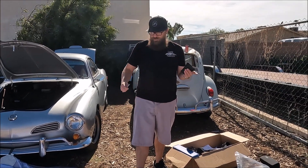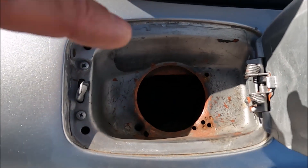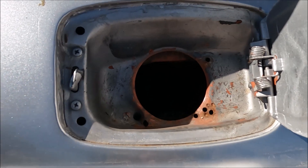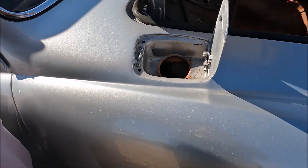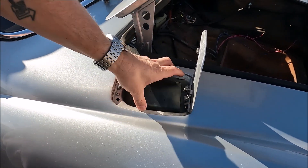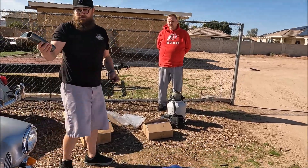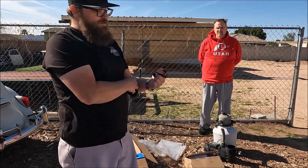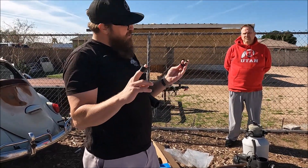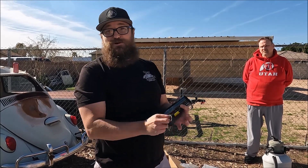I got a throttle cable tube for the engine. This is actually the seal for the fuel filler — at some point a whole bunch of extra holes were drilled in there. I'm guessing when it was converted to electric, the guy used this area for his charge port. We're probably not going to do anything with those extra holes, but this seal will hold the fuel filler neck in there, and we've got to go up through the fender to get it where it needs to be. We also have the fuel pipe, and for some reason every website showed these small pieces as part of the fuel pipe seal — I don't know if they're supposed to stretch over the pipe to help seal better; we'll cross that bridge when we get there.